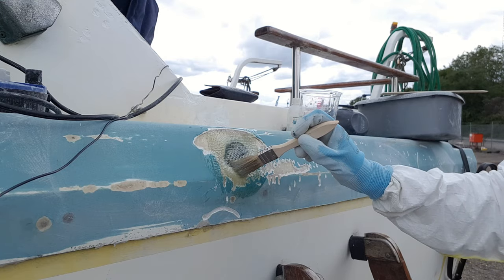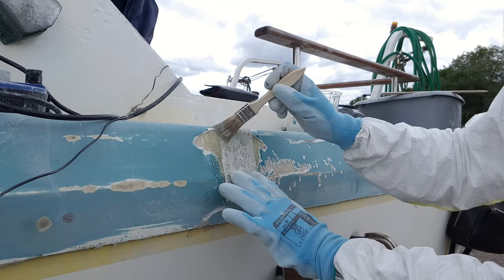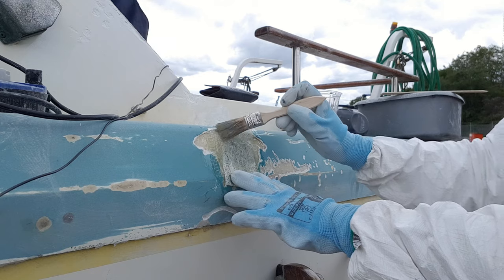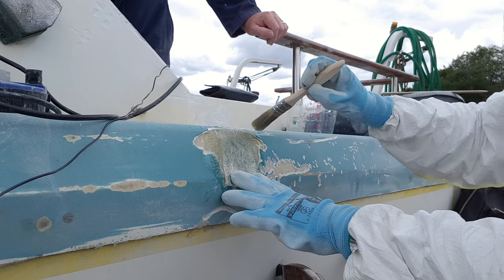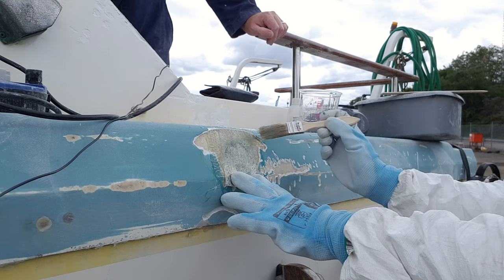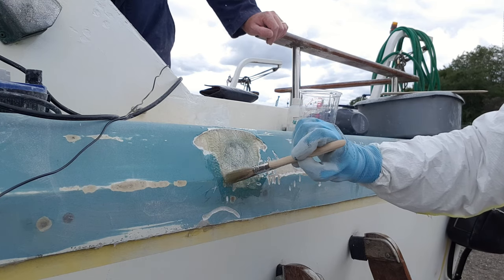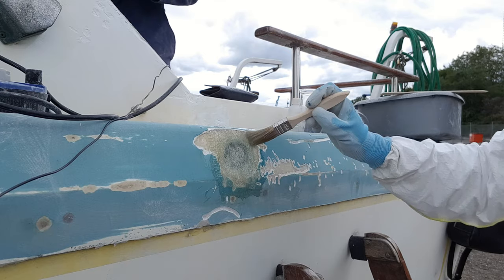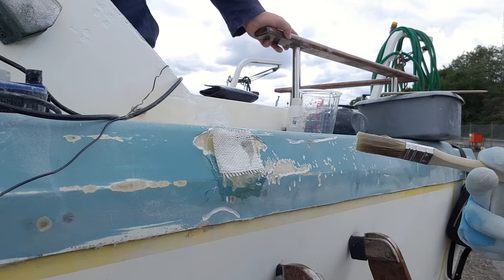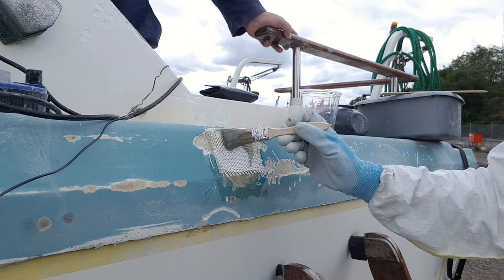Beautiful. It's layer after layer of chop sheet and structured mat being thoroughly wetted in to make sure there are no voids, no bubbles between the layers. Wifey did a really good job on this repair - she did all the grinding, all the cleaning up, patching the glass, and mixing the resin. We mixed 100ml of polyester at two percent because we wanted it to set up fairly quickly. It's never really a good idea to leave external glasswork open to the elements overnight, as a change in weather or temperature can cause the resin to behave strangely if it's curing slowly.